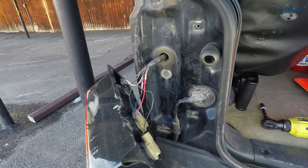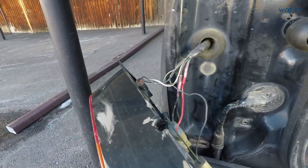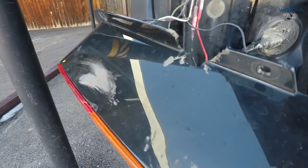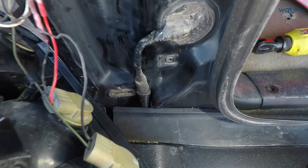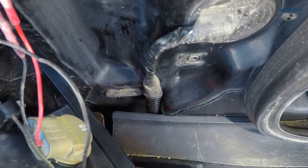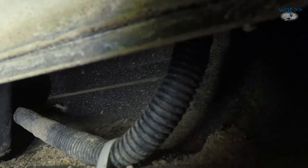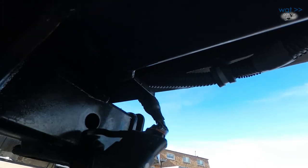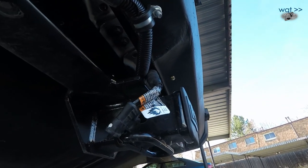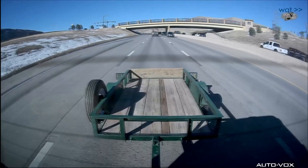Later we also came back and moisture-proofed the body grommet with black RTV silicone. The trailer hitch hasn't been used much in the first year since install, but when needed it's been a good thing to have, and a hitch isn't fully useful without proper trailer wiring. Fortunately, with the available OE-style control box that plugs directly into the factory loom, this isn't too difficult other than the three or four interior panels that have to be removed to access the wiring loom bracket.